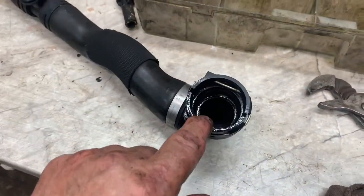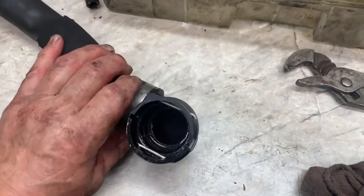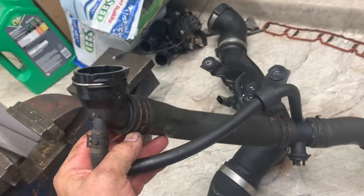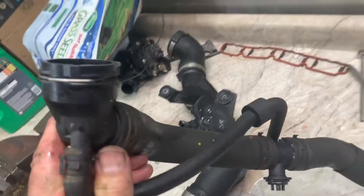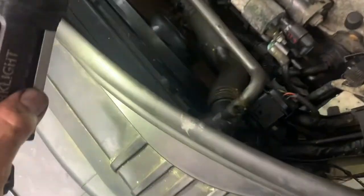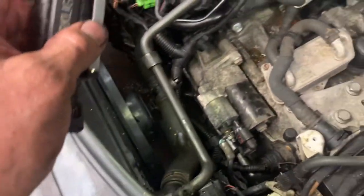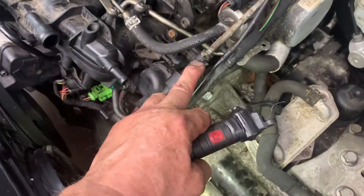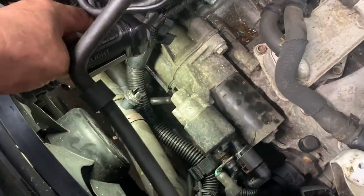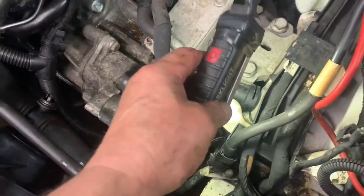For the upper one you've got two different size clips — make sure you clip them in and the small one goes over here. Clip it in that way. Radiator hoses are clipped on — pull down to confirm they don't come off. Put this one on next and don't forget the piece with the little temp sensor inside — that goes on that hose and takes a clip also.